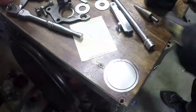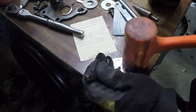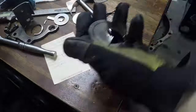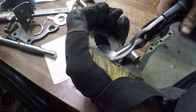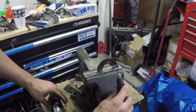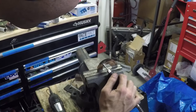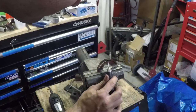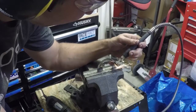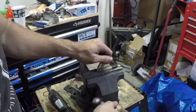So we're cutting these out with some tin snips and trying a few different ways — punching out the center, drilling out the center, cutting with tin snips. None of these really worked very well, so we ended up switching over to the Dremel with the flex shaft and little by little cutting out that intersection until we could get enough daylight to be comfortable, then switching it around and doing the same thing.